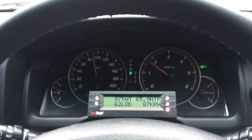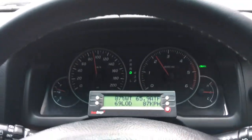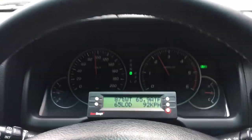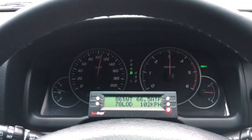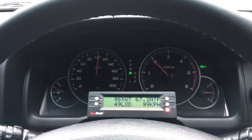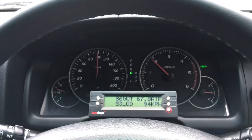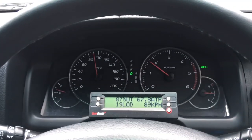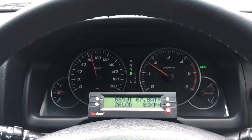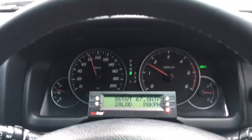You've seen how hard it is to get the torque converter to unlock on this — that's a good example already. We're going uphill now so I'm into it a bit. That was torque converter unlocking — so this is what you take into account: you've got torque converter unlocking and gear changing. That's fifth gear converter lock — there's not a lot we can do here because of the 100km/h speed limit. The torque converter stays locked really well; there's a hill around the corner.